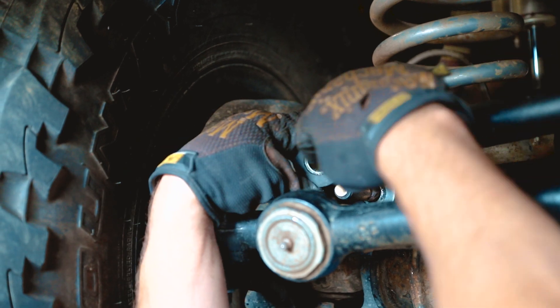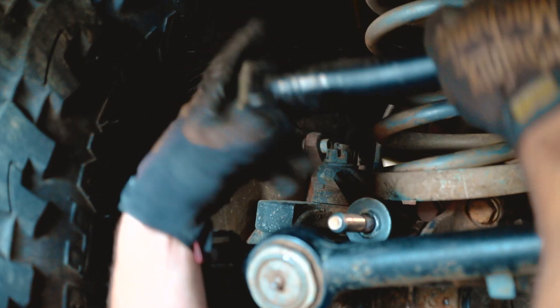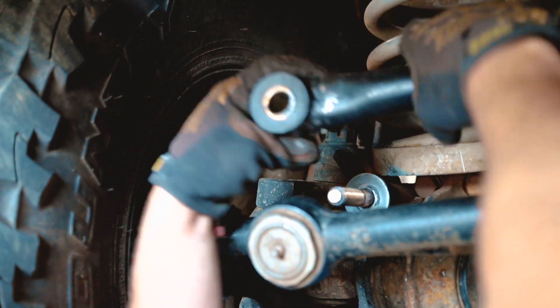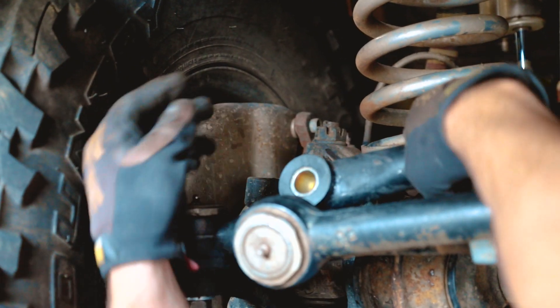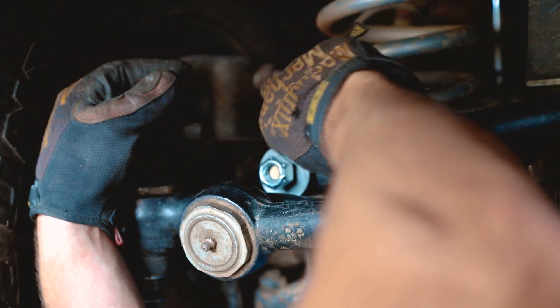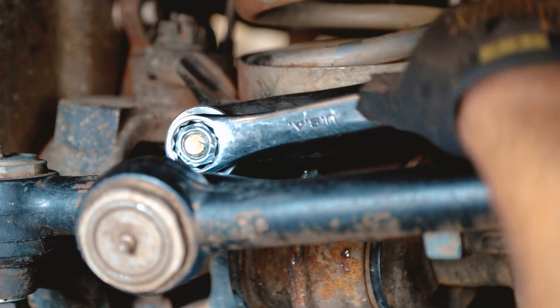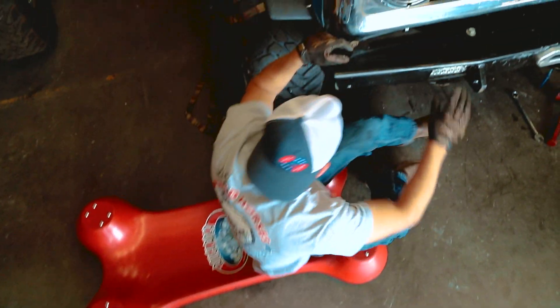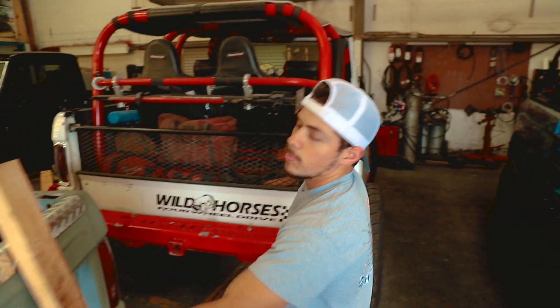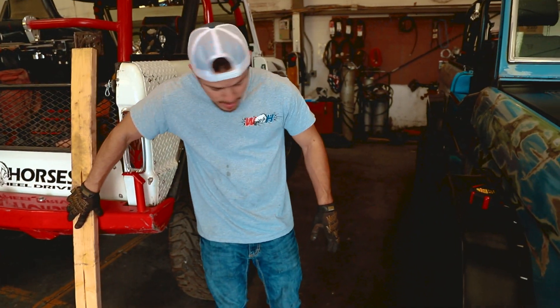As you guys can see, my track bar hole is way too far this way — you're not even going to be able to get it on the stud. Again, this is all custom. So what I'm going to do is tighten the track bar and pull it that way until I can slip it on. We've got a couple more turns and that should be it — and that'll go on nice and easy. All I have to do is throw the hardware back on, tighten everything back up, and I'm going to put blue Loctite on it. Once you've tightened everything down, we'll do a couple more checks. This is with the ratchet strap still on — we're still at three.